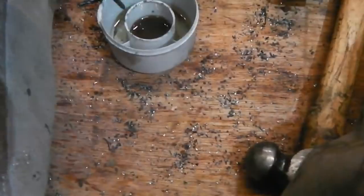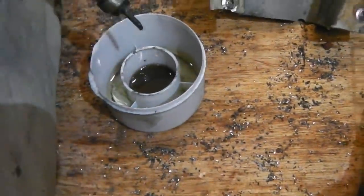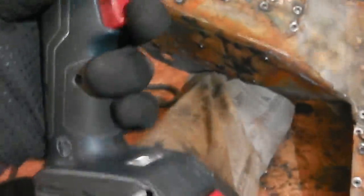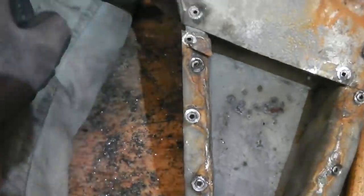Anyway, cutting compound, and then I just dunk the end in, and each time then on a slow speed, speed 1 for me here on the drill. Battery drill with an LED light always helps. Have a good light when you're working as well, which is what we've got. Down tripod on the floor, and I'm today working on the floor. So dunk that in, go nice and slow, start drilling them out.